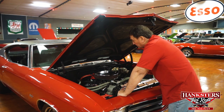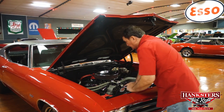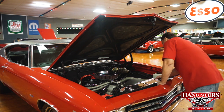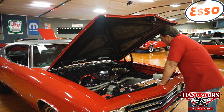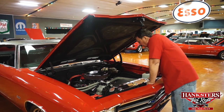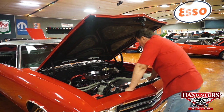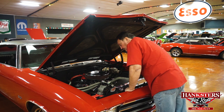The headers transition into what appears to be about a three-inch long-tube collector, which we'll see better once we get it up in the air for the undercarriage presentation. It has a real nice set of high-silicone wires, an absolutely new power brake booster, a new dual-stage master cylinder, stainless-wrapped heater hoses and radiator hoses, and a new alternator.